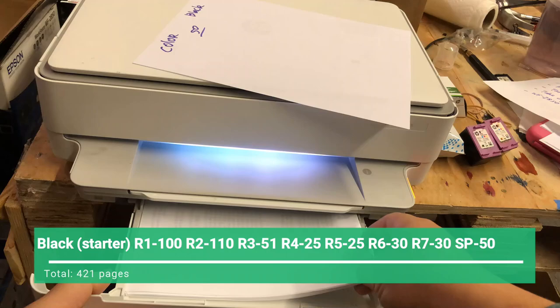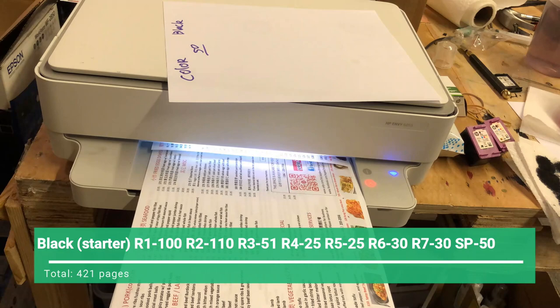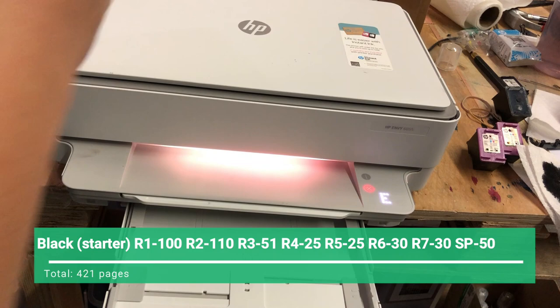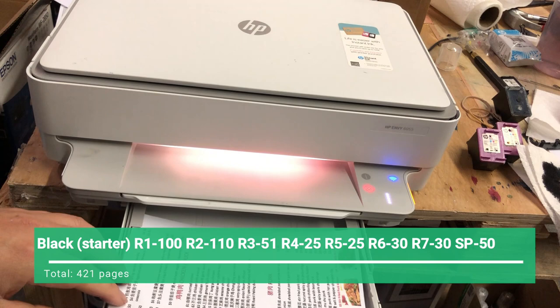During the printing, I got this strange error: E1. If you look it up, E1 means incorrect paper size. I couldn't figure it out until I restarted the printer. It seems sometimes your software is telling the printer you're going to print on another paper size, and somehow the whole system gets messed up. Just restart your printer, restart your computer, and the thing will be fixed.